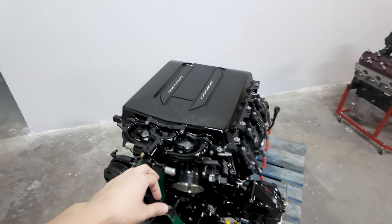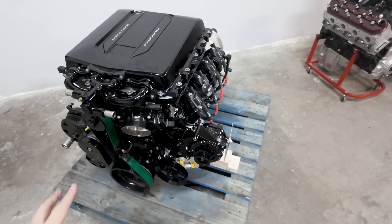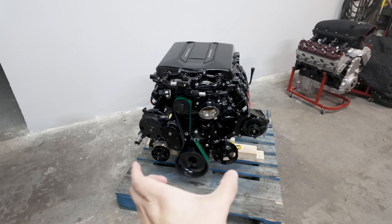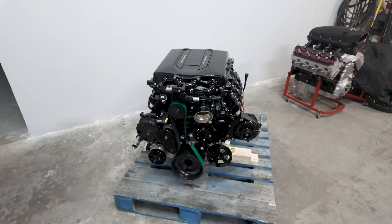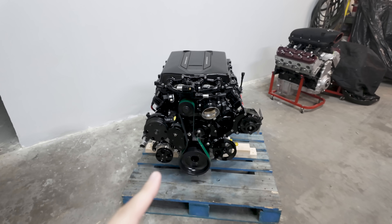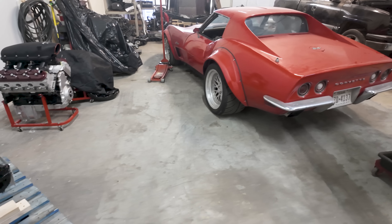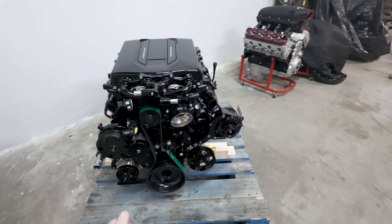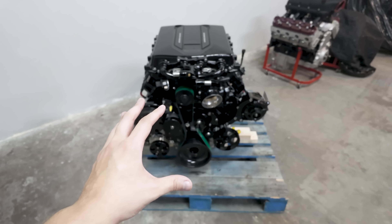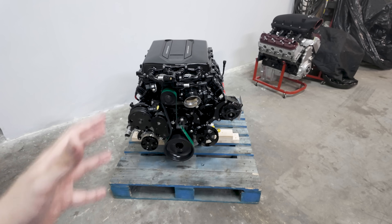These blowers have an electronic bypass valve. It connects here and we have a controller for that. On our accessory drive, we wanted to keep it as compact as possible. We tested this on a lot of chassis — the only one we have a little bit of a problem with is the AC compressor on C3s, but we have an option to move the compressor up a little higher. This fits 99% of all swaps or aftermarket chassis.